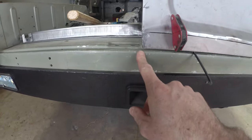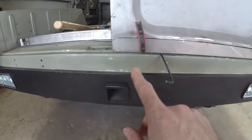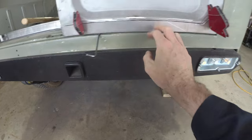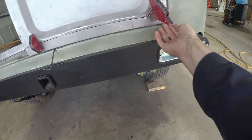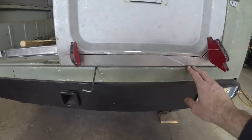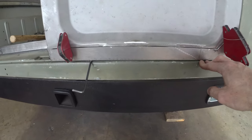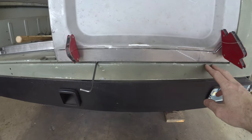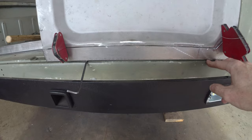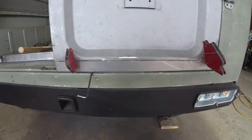So I got that guy trimmed off. It's got a flange wrapped around, nibbled in the corners. Sitting pretty even here. It's just floating, so it wants to droop when I don't have two hands. But measured top to bottom, it's just a skosh under 40 and a quarter. I think it's basically 40 and 3/16 on both sides. So we're looking pretty straight and square that way.